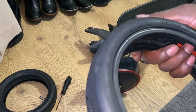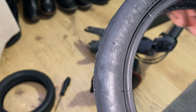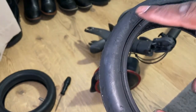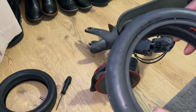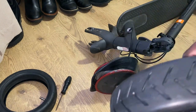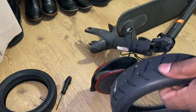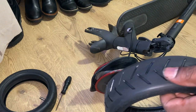Something else to look at — there's an arrow on this tyre. It shows the direction. That's the direction it rotates, so the wheel's got to turn in this direction. The tread seems to be arrowed anyway — this is the direction it has to rotate. I don't think it's a big deal if you put it in the other way, but it was designed this way.